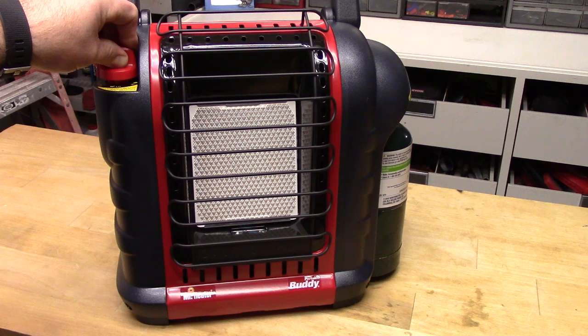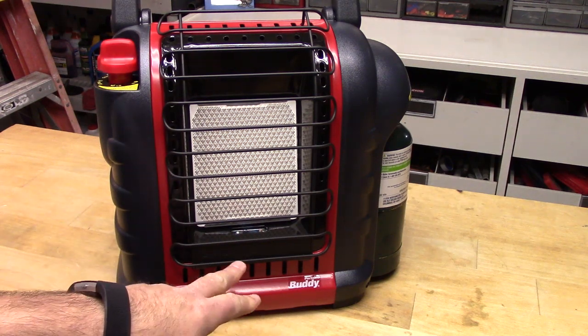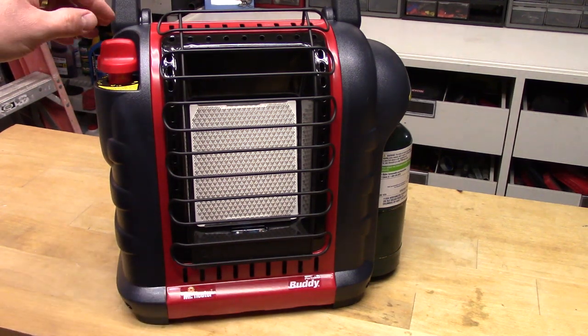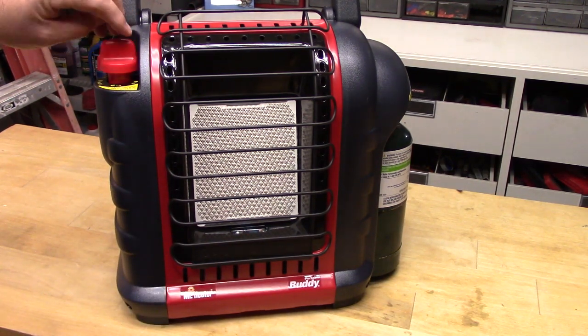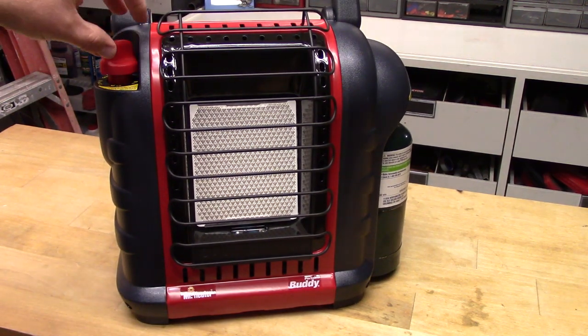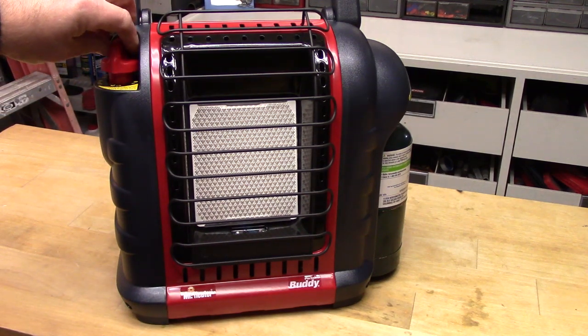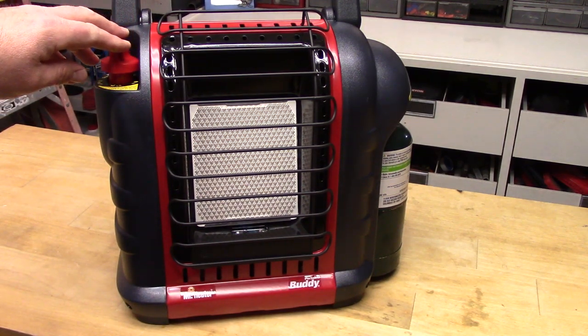Now we hold it for a minute. It's actually not a minute. I'm speaking out of line. They say 30 seconds. I could let go now, and it's new, so it's already engaged. The flame is. Then you push down a little bit, and you turn it. If you just try and turn it without pushing down, it won't turn. I've seen people make that mistake. You turn it to low, and you'll see the flame come up here and ignite.